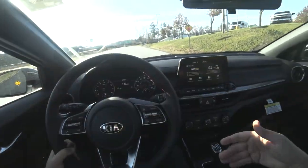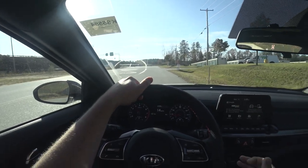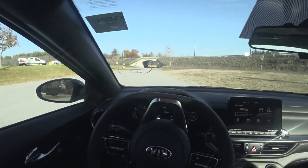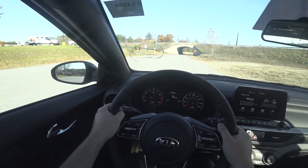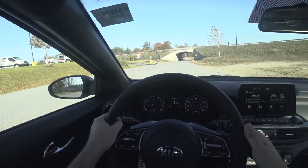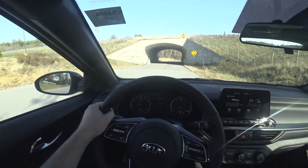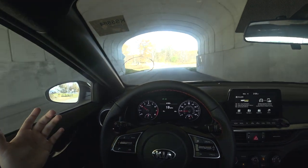Now I'm going to turn around and talk about shifting into the next gear. As everyone knows, the hardest part of driving manual is getting moving. Once you're moving, it's like driving a normal car, except when it comes time to shift. We're going to barely give it any gas — now we're moving. When it comes time to shift, put your hand on the shifter, foot in on the clutch quick, down to second, nice and slow on the clutch — and that's second gear.